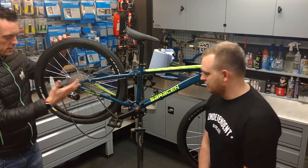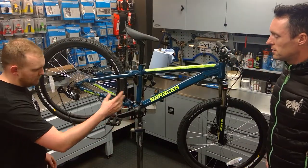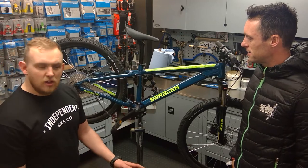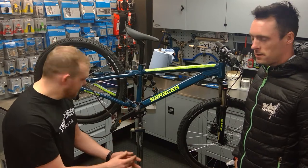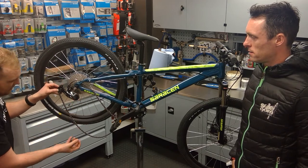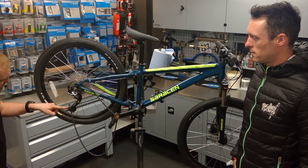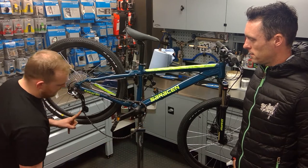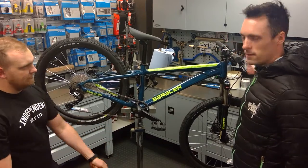The chain has fallen off here. I'm going to show you a really, really quick way. So we're going along, we've hit a bump, we've pedaled incorrectly — whatever — our chain is not working very well at all. So all we've got to do is simply touch this chain and pull it back on the chain ring here. But the best thing to do is use our rear mech here, which is this mechanism here. This is what controls your gears at the back. This is spring loaded. So when our chain is like so, it won't reach. Really simple — all we do is push the mech forward as far as it will go, which will magically give us plenty of chain. And then we just let go and off we go. We're good to go again. Easy as that.